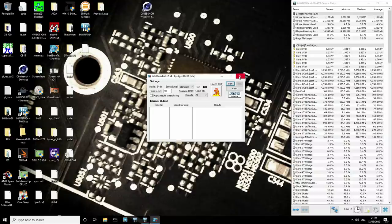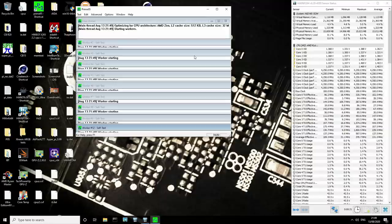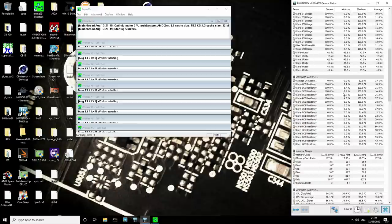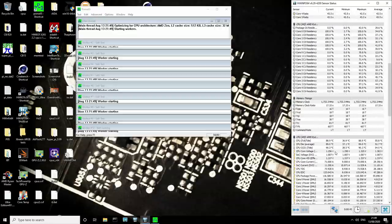No, not Intel Burn Test. Not sure what other workloads I would throw at it. The thing is, Linpack is a bit weird on AMD systems just because it is meant for Intel CPUs, not for AMD CPUs, so it behaves a bit weird. I'm not sure that would actually be a good stress test for this. Prime95 is definitely fine. It's just that I don't like trusting just a single stress test for all of my stability testing. And we lost worker 12,